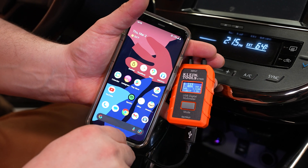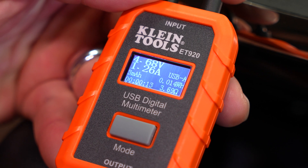In addition to charging, there's a data component too — the digital handshake. Depending on the integrated circuit used, there is oftentimes handshaking where the controller wants to talk to the phone to make sure there's actually a device plugged in. From there it'll set the charge, and some devices like Apple can have dynamic charge rates based on that data flow. So if you have a bad cable or you're dropping your connection, the port may not recognize there's a device and then it may not supply charge or data. We saw a phone with dynamic charging that would vary the charge rate. If some devices don't see that handshake, they may revert to that half amp standard — so even though your phone may want to charge at 2.5 amps, if the electronics don't talk to each other, you may be relegated to that half amp.